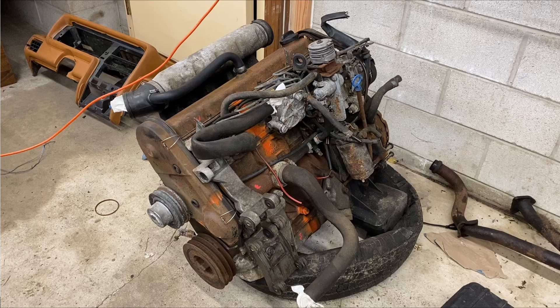Now you might be asking, what are my plans for this thing? Well, it's got the leaky head gasket and it's locked up, so it's going to need a rebuild. I think it's a pretty interesting engine, so I'd like to crack into it and rebuild it anyway. I have about a $500 budget for this rebuild, and it'd be nice to be able to turbo it with that money — but I don't think so. At the very least, I'm going to want to put some head studs in, which will strengthen the head and make us less likely to have head gasket failure in future. As for what I'm going to put it in, I have a very specific swap in mind, but I don't want to get involved in a whole other project when the motor may not be any good. So I'm going to rebuild the motor, and if my interest is gone I'll just sell it — but if not, it'll be another series of videos and another project to add to the pile. Stay tuned.